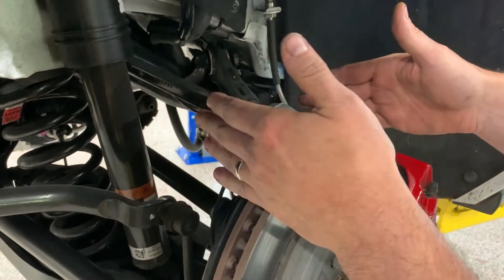These two are the lateral links that we talked about. They come in at an angle and they swing up and down with the whole hub assembly. The bushings are actually pretty good — they're pretty stiff; I don't get any movement. These arms are typically loaded in tension — which is pulling — and compression, which is pushing. So you think, oh my gosh, this little Swiss cheese thing — but actually for the way the arm is loaded, it's structurally sound. If you twisted it or tried to bend it, I could probably bend it over the workbench if I wanted to, but that's not the way it's loaded.